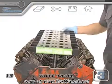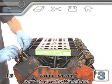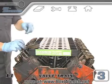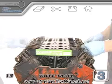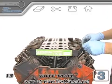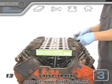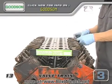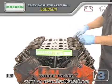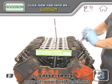There's one extremely important tip to know before you ever pull apart any pieces of the valve train. When the valve train is taken apart, everything has to be organized so that during reassembly, the parts will go back into the exact same positions that they came from. Otherwise, excessive wear will happen if the parts aren't matched back to their original placements and paired with their companion parts. However, this only applies to parts that are going to be reused. If you get new components, they can be mismatched.